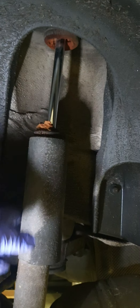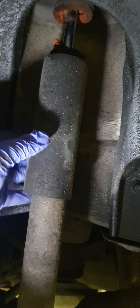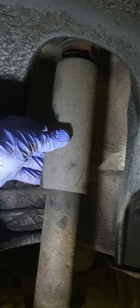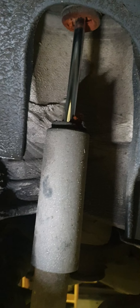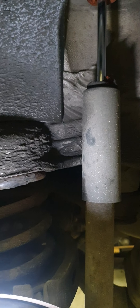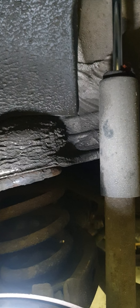You can also see the bump stop here which is a bit worn, so that would be making a noise as well. Unfortunately I don't have a replacement bump stop today but I'll do that down the line — it should be sitting properly. This is a gas shock, and the gas has likely escaped. What the customer is experiencing is a thumping noise going up and down over bumps.